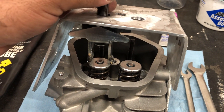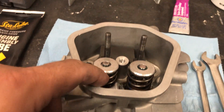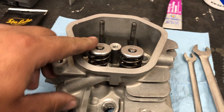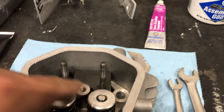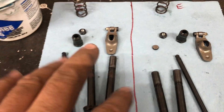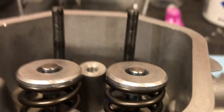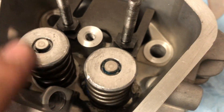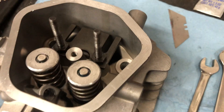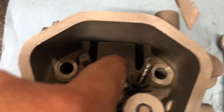It worked flawlessly to get those split keepers in. I'd advise that if you're running high RPM, make sure you've got stiffer valve springs. These are aluminum retainers with split keepers - an automotive-style setup. I also got lash caps. Take note of which one came from where because one may be a little bit taller than the other, as you can see the stem height is a little different. Obviously put the more shallow one where the keepers are closer to the top. You can see what happens when you don't have a spring compressor and try to do it with all kinds of stuff - it was a pain. This is the billet guide plate for the chrome-moly pushrods.